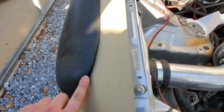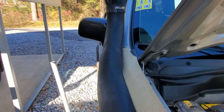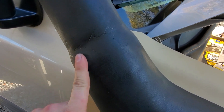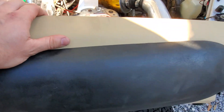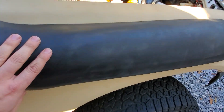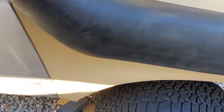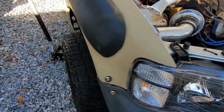I had to melt this snorkel and bend it over - I cut here and re-welded it back, plastic welded it back on. There's this awkward transition I'm not really a fan of, but what ended up happening was it bent this fender basically all out of shape. I do have the original fender - I've had a lot of parts from other series, so I can always go back to stock, which is kind of nice.